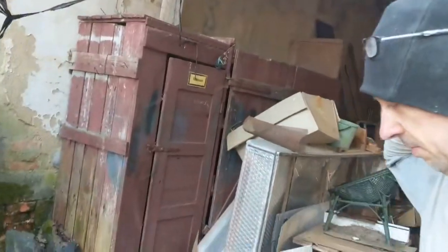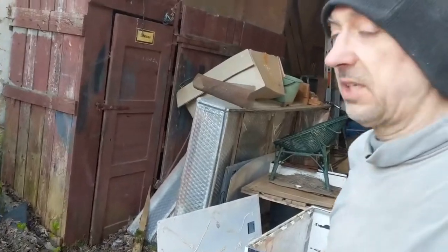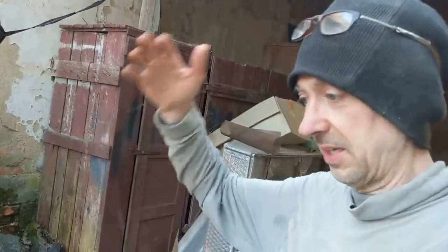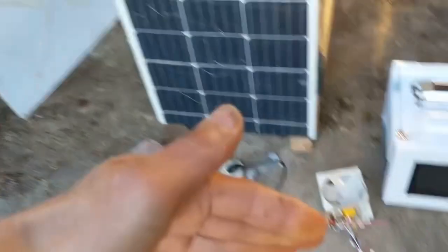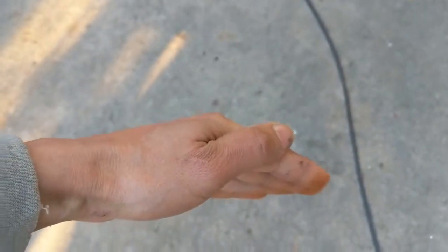But of course the wood, the logs will go all the way, and therefore some lot of radiation will go through the wood into the entire 7.5 meter cage, and so the heat will dissipate over the entire 7.5 meter. But you see, it's this law, one divided by the square of the distance. So you see, if the radiation here now was 1 watt, then double, it would only be a quarter of a watt, and if you double it again, it would only be a quarter of a quarter.